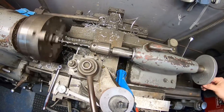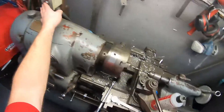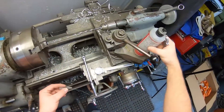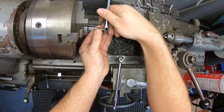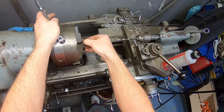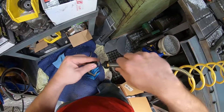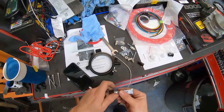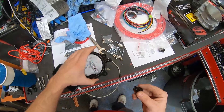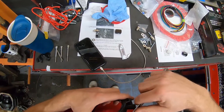Here I'm plunging in with the drill bit — it's always interesting drilling on a lathe because the part is turning and the bit stays still. The lathe is one of my favorite tools in the shop. Once drilled, I take some aluminum cutting fluid on the tap, lock the chuck, and run the tap in and out to tap the hole. Then I pull the part out, blow out any metal chips with compressed air so we don't clog the nozzle, and put the part right into the throttle plate — perfect. Using Snow Performance's special sealing compound on the threads to make sure it doesn't leak, and we're good to go.